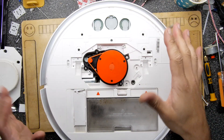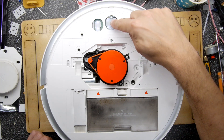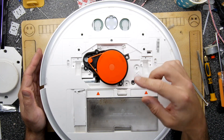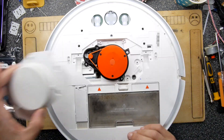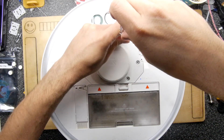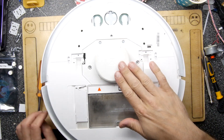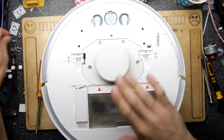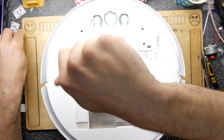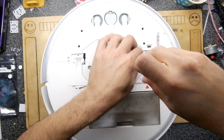At this point you can actually test it without having to put anything else on. Push the on button to power it up, then tell it to do some cleaning. Starting to clean — you can see that's spinning as expected. Once you've done your little test, make sure you don't suck up all your screws with it. You can put all your panels back on. Make sure when you put this on, you've used the smaller screws at the front because you need that pivot — you'll hear it click. If it's not clicking, there's definitely something wrong. Put these three in and just keep spinning them all the way down until they just hit the deck. And you're pretty much done.